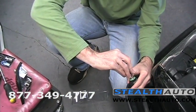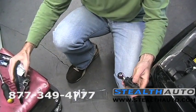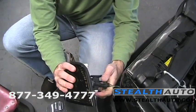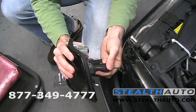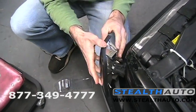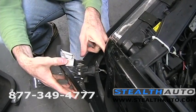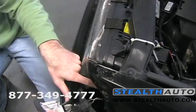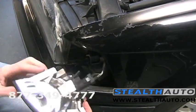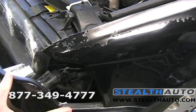Push this into place — it clips on in two spots on the side of the bulb. Make sure you hear that click before you put it back in. As you're putting the light back in, remember there's a guide in here — there's a guide that this notch fits into, and then there's a hole that locks in the position on the end.